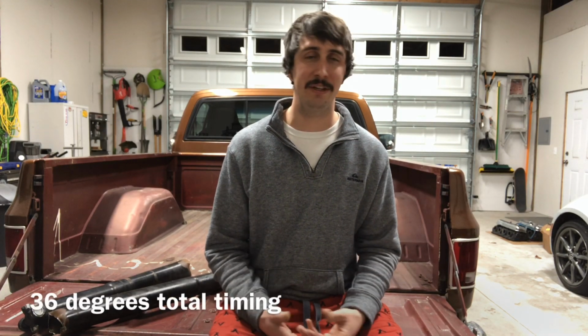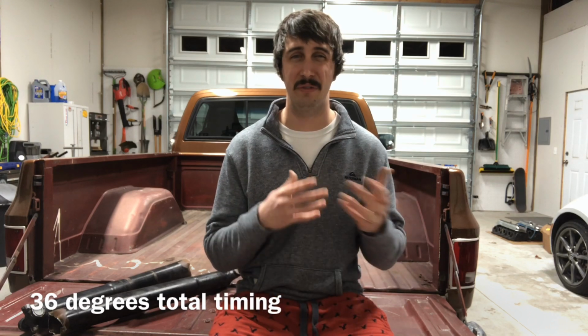The other thing with this truck being the T56 at highway speeds, meaning in Utah here, that's 70 miles an hour, 80 miles an hour is the speed limit. You run into it actually being too low of RPM. You kind of feel like you're lugging the truck. Now, when they did the tune, I think he added 2 degrees of timing almost anywhere, so that might help, but at 75 miles an hour, you're roughly 1350, 1400 RPM.